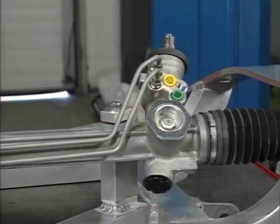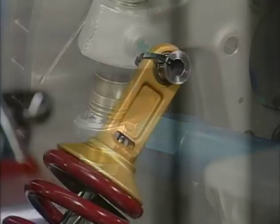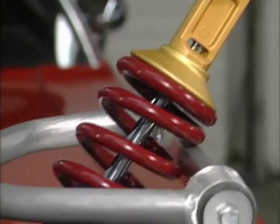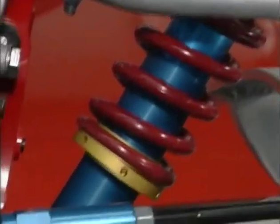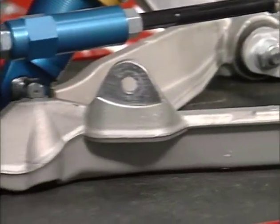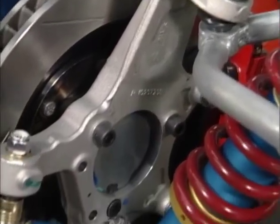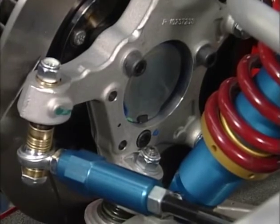We designed and built all the front suspension out of high-strength 6061 T6 aluminum tubing, quarter wall. We used a rack and pinion steering system to give good road feel and feedback from the tires. We've got a coilover system with dynamic dampers developed with multi-matic that are going to be specially valved on the four-post rig. We've got a cast aluminum lower control arm, a fabricated aluminum upper control arm, and an aluminum upright with a heavy-duty bearing assembly, sealed for life.